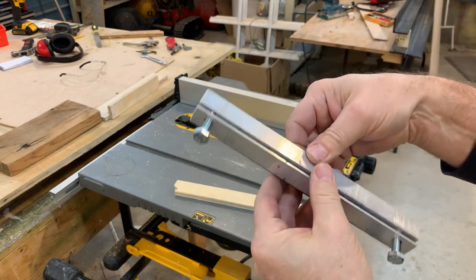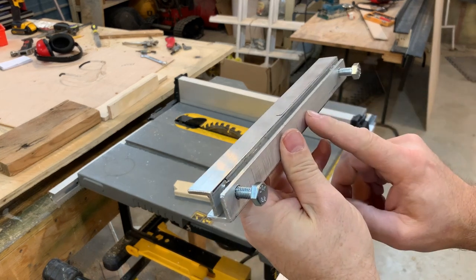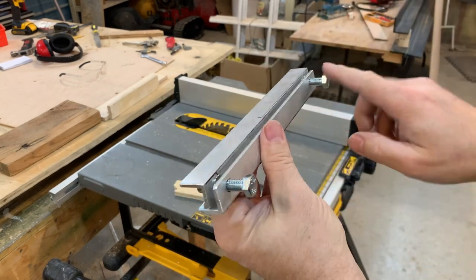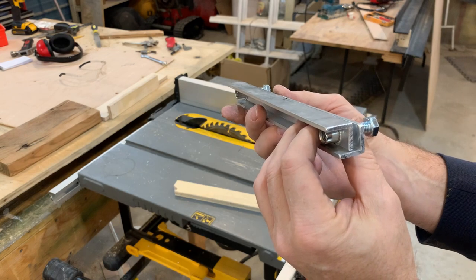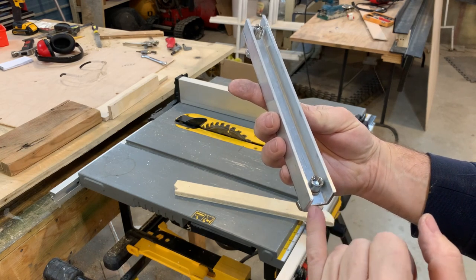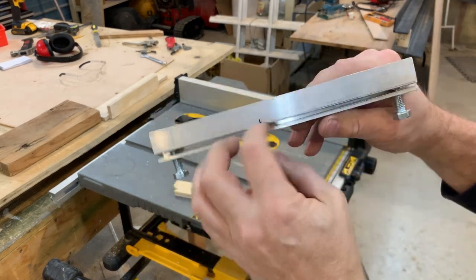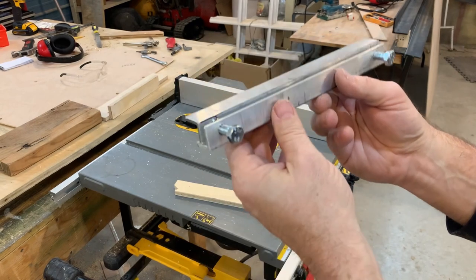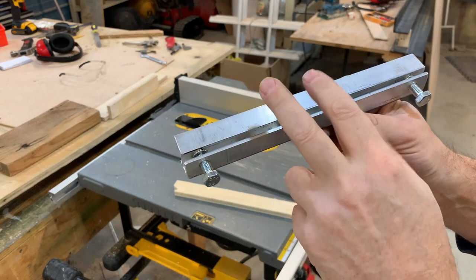Now that I've got this all working, this part here will be riveted inside the door, and the actual door panel and fabric will be between it. This part will be held with just two bolts, giving you a good reinforced pull on the door without just pulling on the tin. What I had to do on the table saw was reduce the thickness of this piece of metal so I could have the outer piece slip over top of it, since the door panel isn't that particularly wide. I wanted the holes to be more or less centered visually, since this is the only part you see.